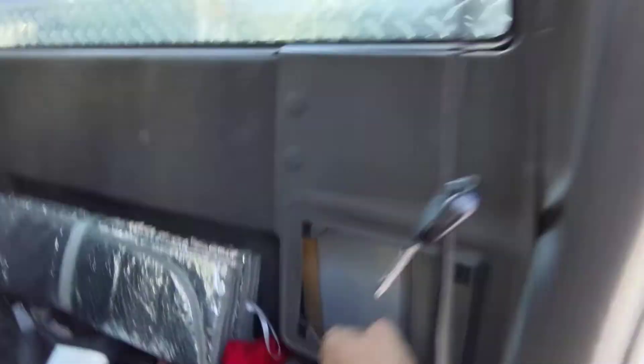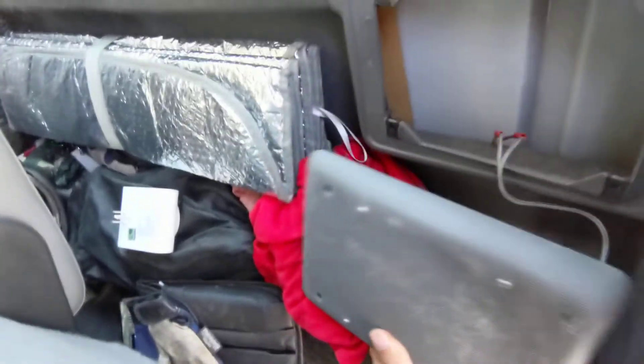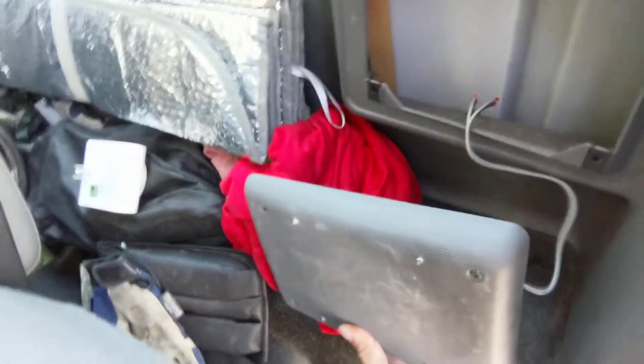You can feel the speakers right behind you kick in — turn up that bass if you want, it's definitely awesome. Make sure when you install the speaker, especially on the back right, you put some cardboard or foam on the back of it, otherwise it may rattle against the middle of your cab. Also, maybe don't use the screws that come with the speakers — as you can see these are sticking out because they're too long. Get some shorter screws instead.